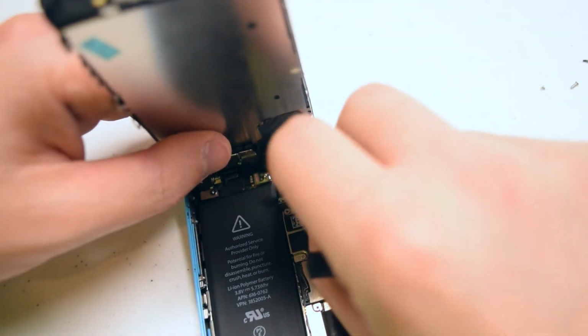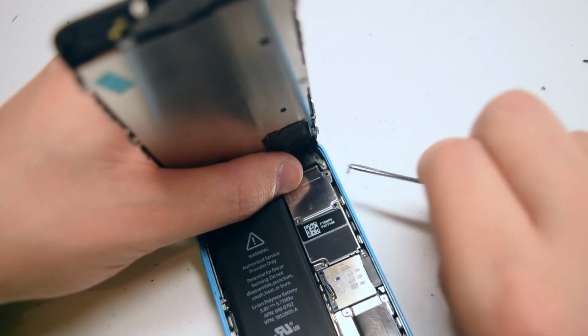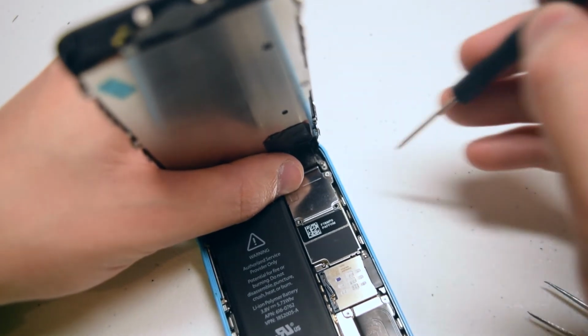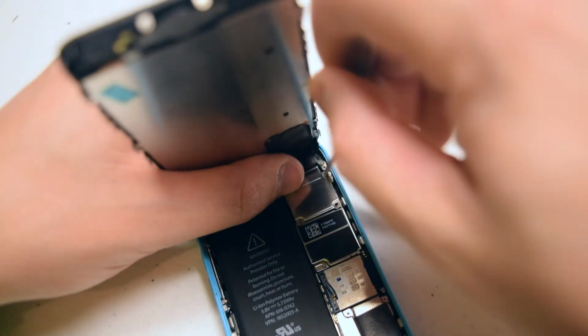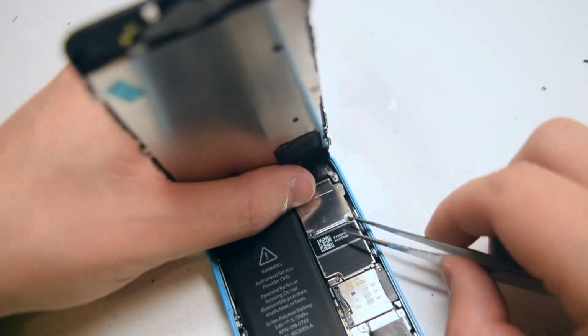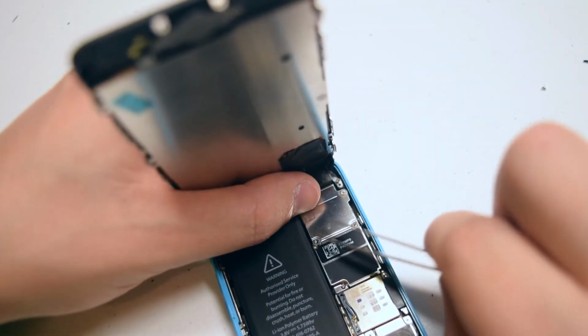Let's place the shield back on. In the following orientation, go ahead, lay down the shield and secure it with the 4 Phillips head screws with the long screw in the top right. If you have them mixed up, just make sure that this screw goes in the top right and then the shorter ones go around the contour of the I/O shield. Resecure the remaining screws.